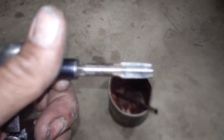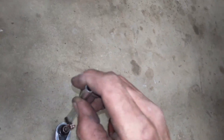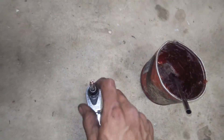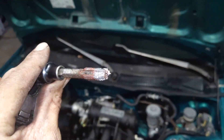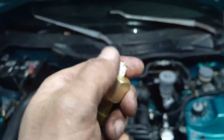What I do to tap on the intake manifold and not have shavings fall inside: I'm gonna grab a little bit of grease and grease it up so all the metal shavings stay on the tap. Just like that, when you bring it back out, they're gonna stick right there and you're gonna have the minimum amount of shavings going inside the intake. Now you can see all the shavings stuck to the tap. Then I add some Teflon tape and go ahead and install it carefully.